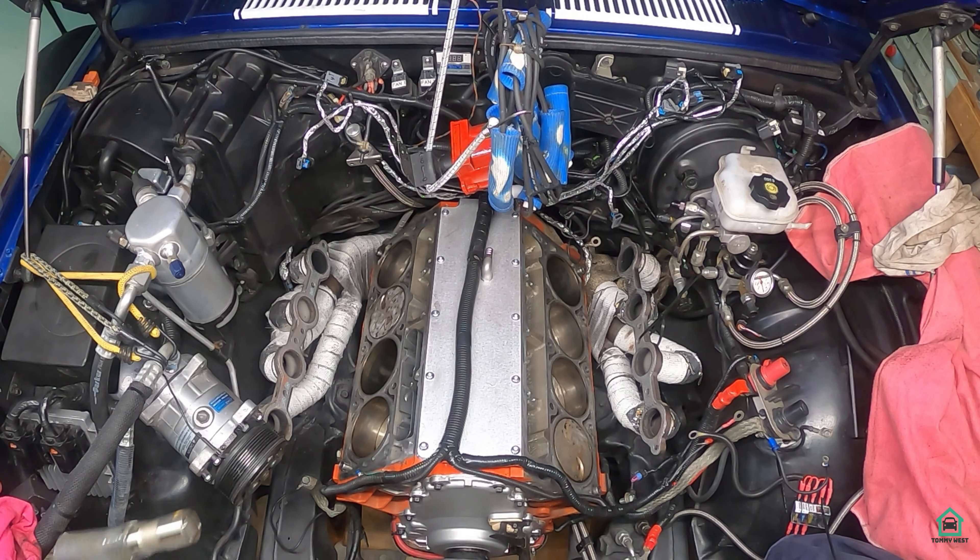I accidentally unplugged my microphone so you get this voiceover. Here you see me putting in the LS7-style lifters from Texas Speed into the new lifter trays. They have two flats on each side and a vent on the end — it doesn't matter which side the vent faces. I pointed them all toward the rear. They just snap in and go. The lifters are pre-lubed and slide in with the two little flats locking into each side of the lifter tray. It's a shampoo-rinse-and-repeat operation for the other 12 lifters.